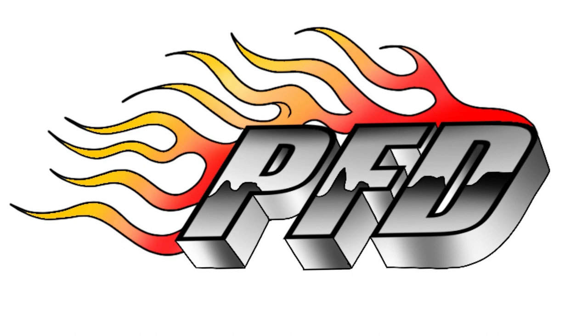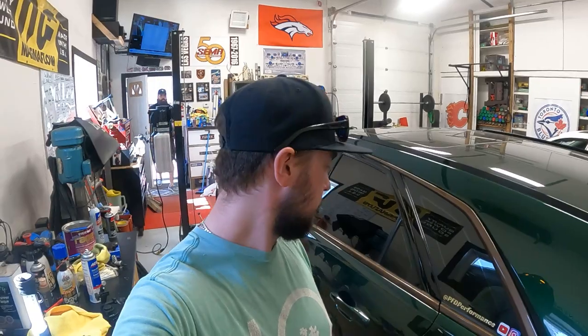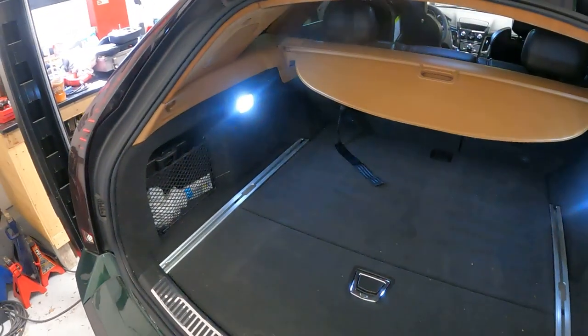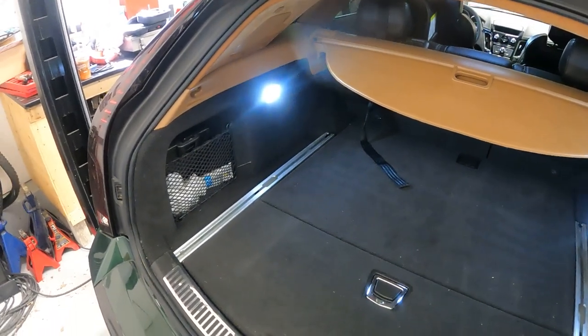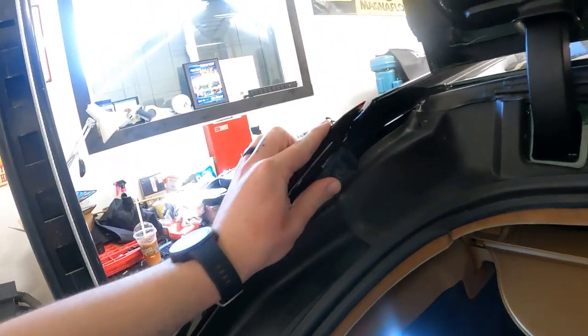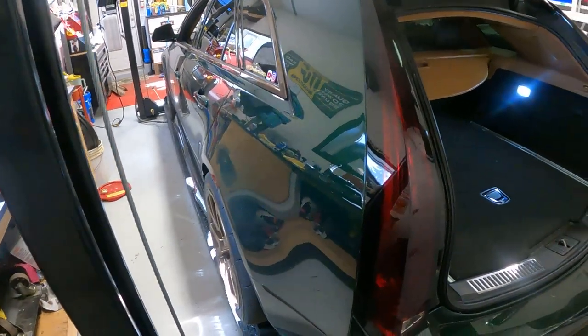Pretty friggin' deadly. Hello. Today, we are starting to get the Cadillac disassembled so we can put Ramsey's new coilovers in it. We're gonna do that. Subframe bushings. So we just gotta gut the back of the car first so we can get access to the top of the strut mounts that are in there somewhere. So all this has to come out. Luckily, we've got some practice with it. And then do that, get the car up, get the wheels off, get ready to take the subframe out, maybe fix the old taillight problem these things are prone to while everything's apart. We can get the lights off, so yeah, gonna get at it.